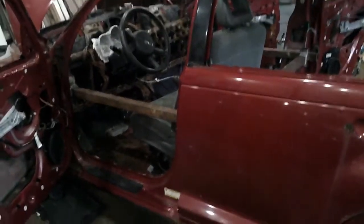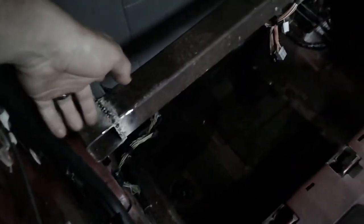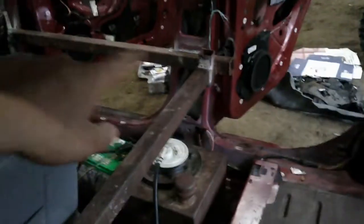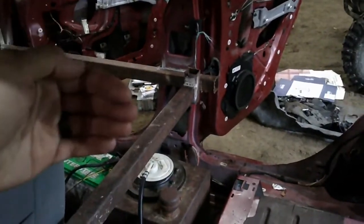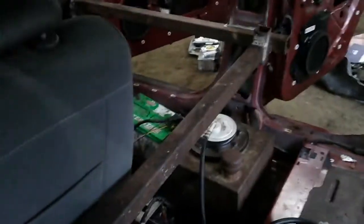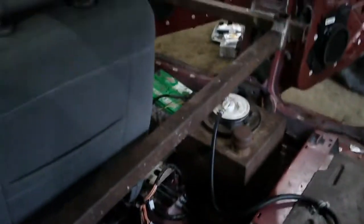Just a couple days out, we've got our cage welded in. With my cheap gasless welder, I'm pretty pleased with how it came out. I got smart this time and did the side pieces first, then did the bar going from inside the side piece so as cars slam me they're pressing on that. The one thing I'm a little nervous about is the weld along the vehicle — it's not a garbage weld, but I'm nervous about it holding when I'm getting smashed. I'll probably run a cheap ratchet strap from up there under the crossbar, so if it falls, the strap catches it and it won't drop into my fuel cell and break my fuel line.